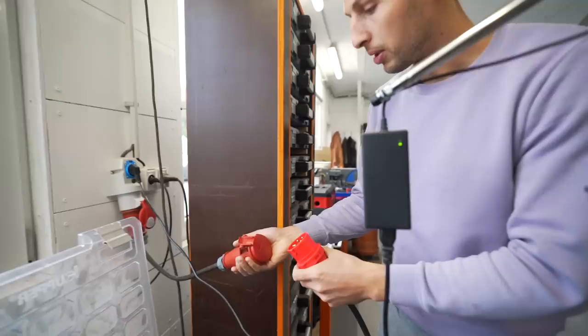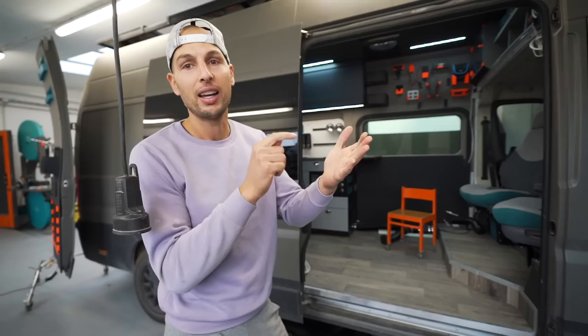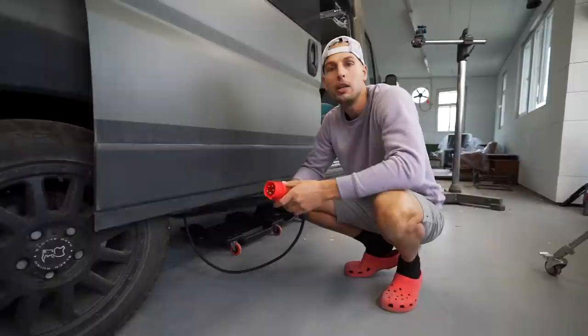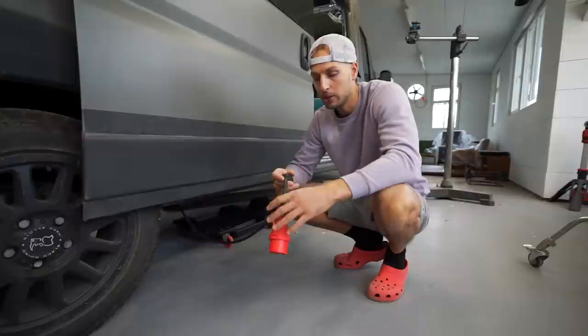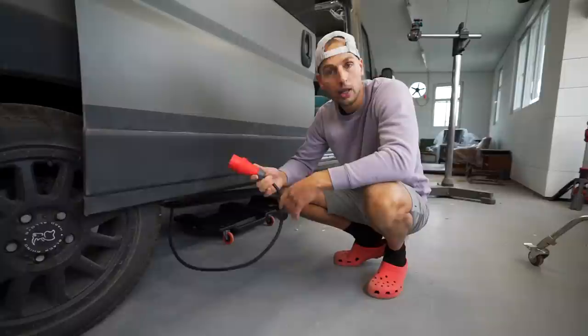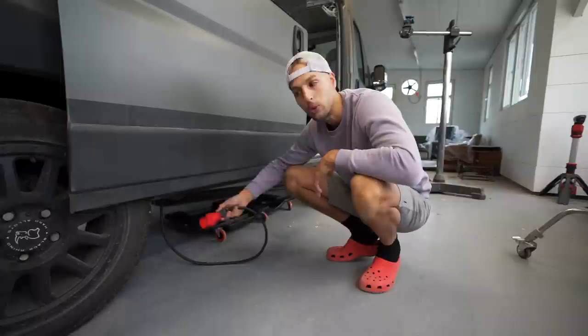The whole car automatically switches from inverter to this grid and then wirelessly from my phone I can use the relay and start charging the lithium with two kilowatts. Take this as a prototype — we're not even close to being at a finished stage. We're definitely going to seal all of this intake where water would eventually get, and we're definitely going to 3D-print a nice hook and cover for all of these connectors, so you can pull it out, retract it back, and slide it into a waterproof slot that holds it in place.